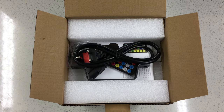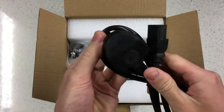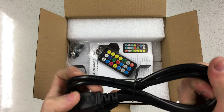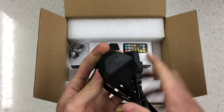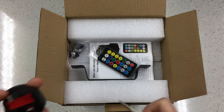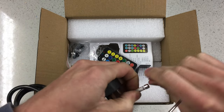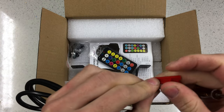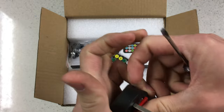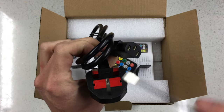In the box the first thing we see is a power cable with an appropriate plug - this is a UK plug. The quality on this feels okay, it's better than a lot I've had. It's all molded, it says it's 13 amp. Let's have a look what fuse is in it - that's usually a good indication. It reckons yeah, it's brown and it's 13 amp, so that could well be an alright mains cable. A lot of these come with very cheap nasty mains leads. We'll check it with a meter just to make sure it's wired the right way around later on.